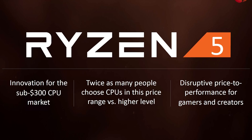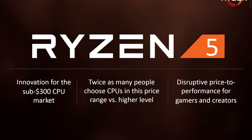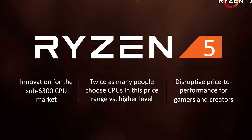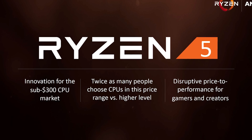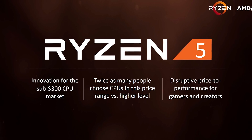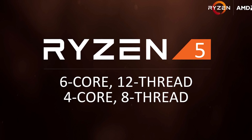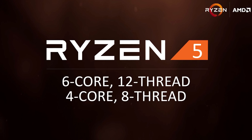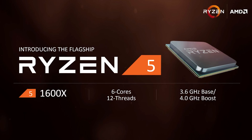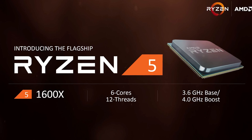The upcoming Ryzen 5 6-core and 4-core CPUs are based on the same physical chip as Ryzen 7, meaning all models feature two CCXs each with four cores, though not all will be enabled. Ryzen 7 CPUs with defective cores will be binned as Ryzen 5 parts. The 6-core models feature one core disabled per CCX, while the quad-core parts feature two cores disabled per CCX. The news that quad-core Ryzen 5 parts still utilize two CCX units disappointed many, as they hoped the four-core models would avoid the latency penalty. With just two cores per CCX, the latency penalty will be amplified.